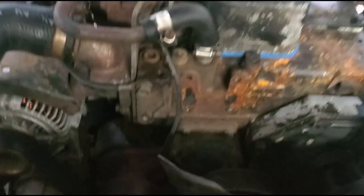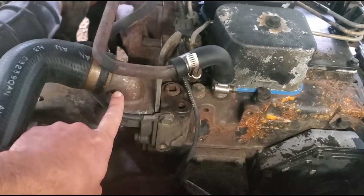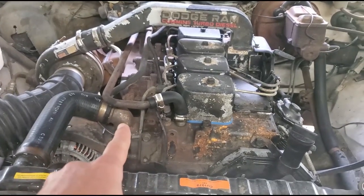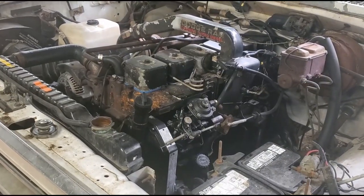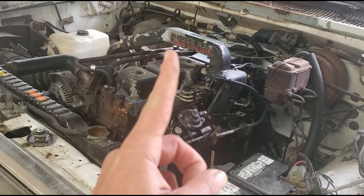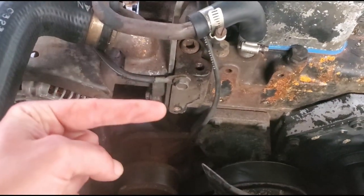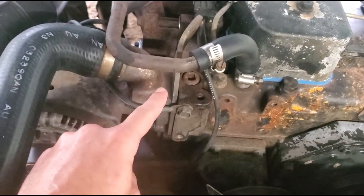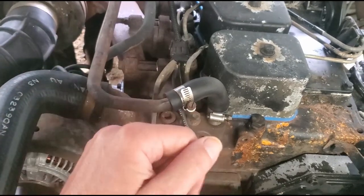Another thing we need to work on — since I'll be replacing the water pump, I am fairly confident that this truck doesn't have a thermostat. At one point it already had a heating issue. This is a relatively new radiator, and of course they lost the fan shroud. I'm thinking at one point they either removed that thermostat or it stuck open, because this truck does not heat up. It runs so cool that it barely made it to the quarter part of the gauge even while doing burnouts. So since we're replacing the water pump, we've got to drain the antifreeze. We'll go ahead and crack this open and find out — does it have a thermostat or is this one stuck open? What are y'all's guesses? Leave a comment down below and we'll find out the mystery of why this clapped out Cummins doesn't heat up.